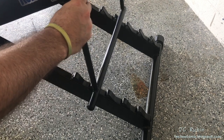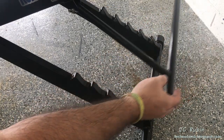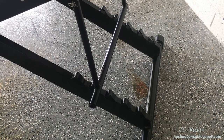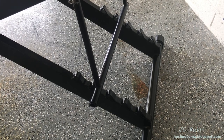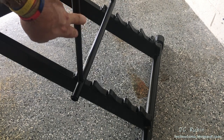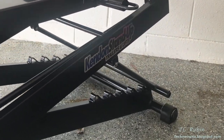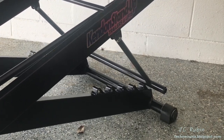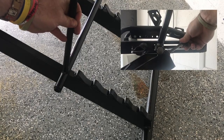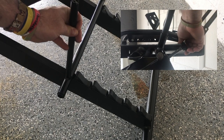I would have thought there would have been a weak spring pulling the safety bar automatically into the next gate as the jack went up, then allowing you to lock it all the way up when dropping the jack down. This functionality was called out in the 2019 redesign — it does automatically lock into the first or second gate, but it doesn't lock into any other gates thereafter. So I have to manually hold the bar into the top gate while turning the hydraulic release to lower the jack, locking it into safety.